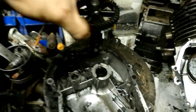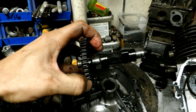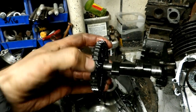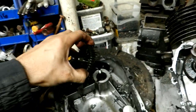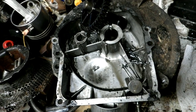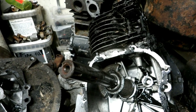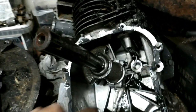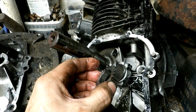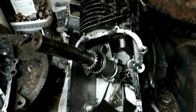Here's the engine internals. It's got the standard plastic camshaft, and this one doesn't have the spring-loaded compression release on the exhaust or intake. The main reason I took it apart was it had a little bit of water in the oil — when I see that, I tear the piston out to let the rings dry out. It's got standard 5/16ths thread on the connecting rod bolts, and it's got a steel gear on the crankshaft, which I kind of like a lot better than a plastic one.